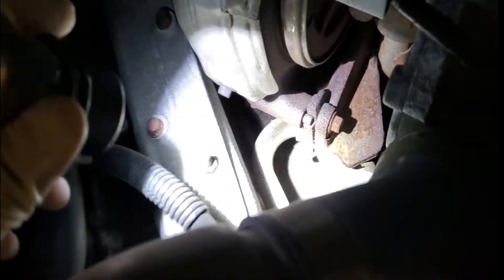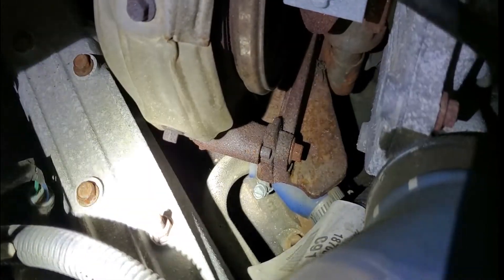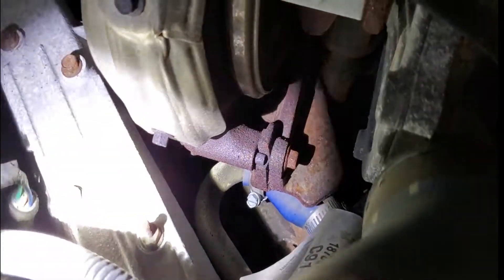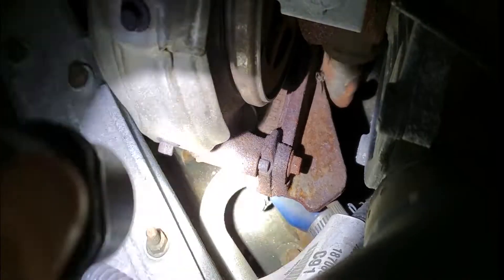The first one — wow, we don't have an EGR cooler on this truck — but for those that do, the quick disconnect, orange or the newer style blue one, I often see those leak and get all crusty. You'll see coolant all down possibly around the bell housing or all in your engine valley.